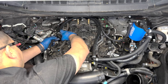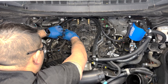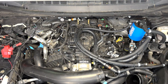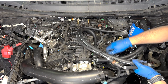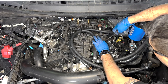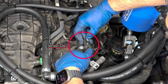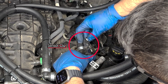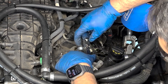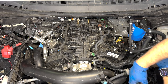I got to removing the PCV system off both valve covers, the intake manifold, the turbo inlet tubes, and the cool side charged air pipe running to the throttle body. These hoses are attached with connectors that you squeeze on one side and then use a flathead screwdriver to pull out the clip on the other side. If they've never been removed before, it can be very difficult to pull them off even with them being fully unclipped. There is a sensor attached to the driver's side valve cover pipe, and five total connections between the valve covers and the intake manifold. All of the extra hoses visible here are for my air oil separator — it's much more simple on the stock system.